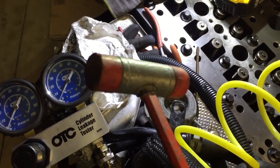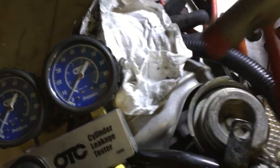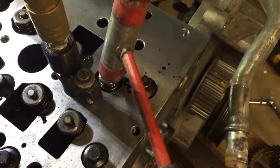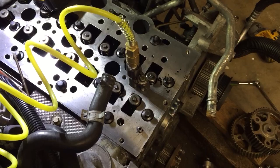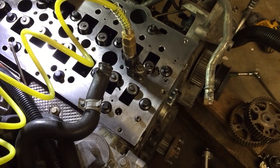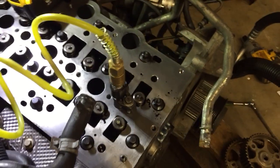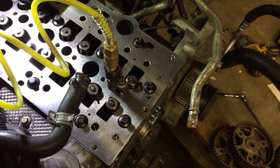So I took my trusty little rubber hammer here — it's not nylon, it's actually rubber, so you can tap on stuff and not destroy something. By tapping on them, I simulate pushing down with the cam. I could also do this with the cams in place and turn the engine with the timing belt. What happened is that the one that broke wasn't sealing good. Once I ran up the pressure and gave it a couple good taps, there was probably some little bit of carbon I was able to blow out, because now it's sealing good.